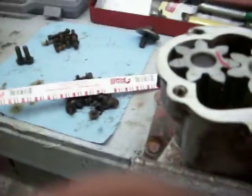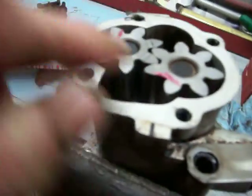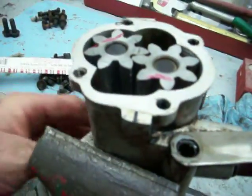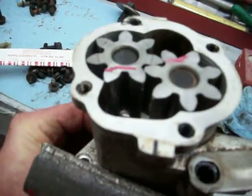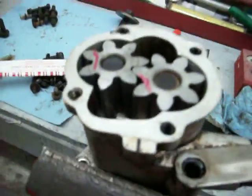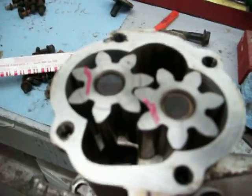What I don't like about this oil pump is I can barely turn the thing — the edges of the gears are pretty damaged. There's a lot of debris that's gone through there. It's just not worth putting back in. I think another oil pump for this will be around $30 or so, so we'll have to add that to the list.